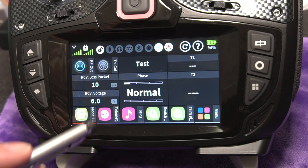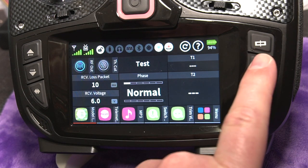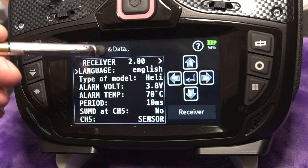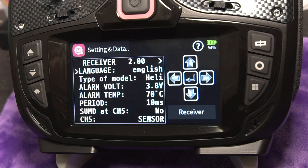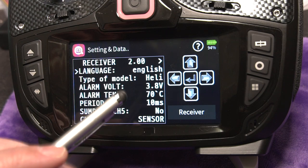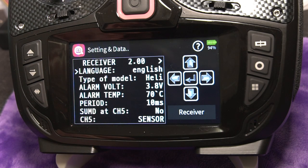You can hit telemetry in two ways: through a button set up on the touch screen, or using the hard button on the right — that little circle. Up here you can see the firmware version currently loaded. I have 2.00. If you had quadcopter firmware installed it would say Q something — Q06 is the latest for the Falcon, so you don't want that if you want to fly a helicopter. I notice I'm out of date; it should be 205, so I'll do a quick update when I'm done here and I might throw that on the video as well.